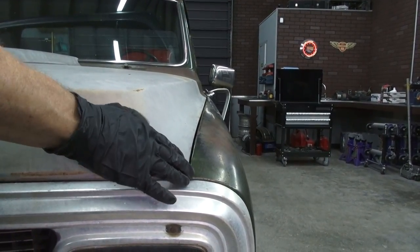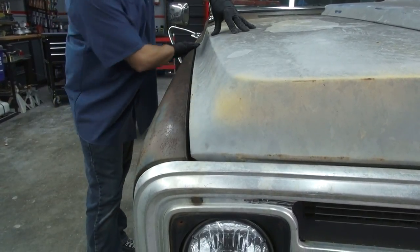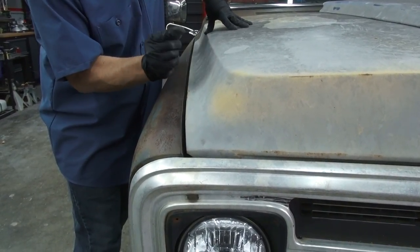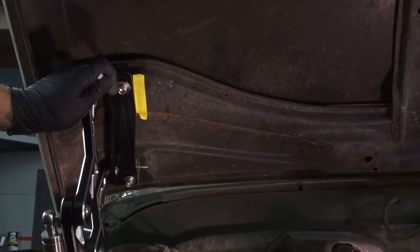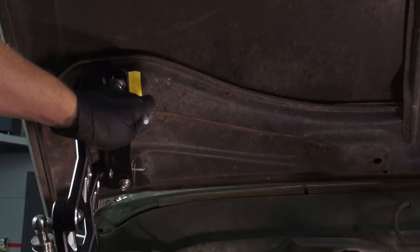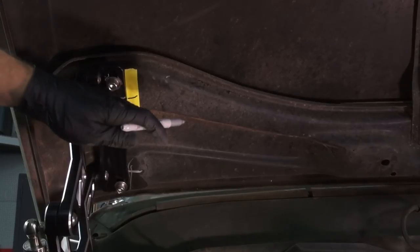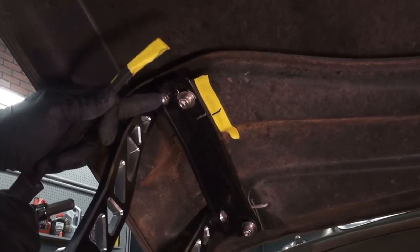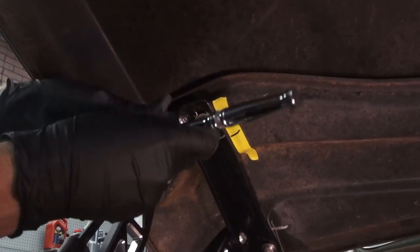Now we're looking pretty good — this is consistent all the way back to the back of the hood. It's still a little bit narrow. On the other side, same thing — it's parallel front to rear. We're in good shape except the gap is larger than the driver's side gap, so we have to move the entire hood back this way just to taste. I've got another piece of tape here just for reference. Since I'm okay front to rear, I'm going to mark this off just to make sure we know where we can go back to just in case we slip. These hard-coated hinges — it's easy to get the ink markers off, so this is just a nice alignment tool. We're going to do this one bolt at a time. I've taped off my pry bar so I can carefully adjust the hood without damaging the aluminum.